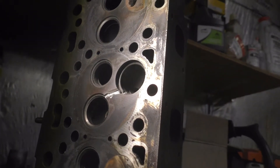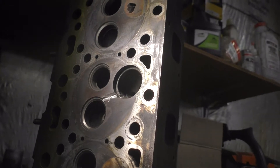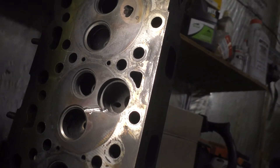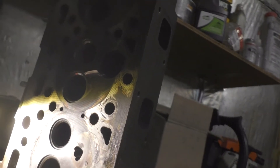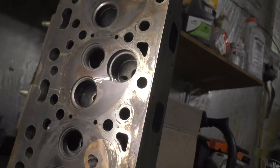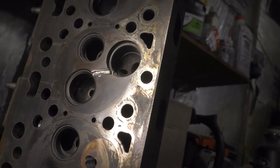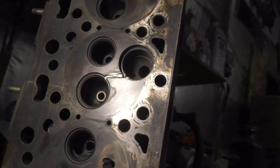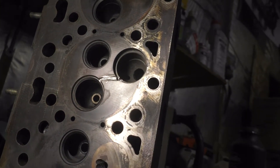I got a nice little groove ground in to lay the weld in. I might have to clean up this area to get the cut back in, but I wasn't able to get the valve seat out. I didn't get into the actual seat area itself with any grinding, so I'll probably just lap it back in.